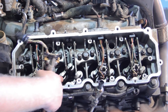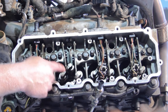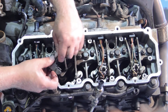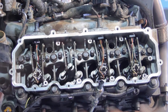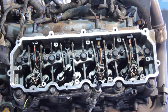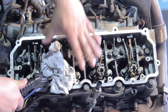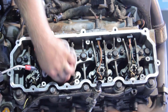We're going to take some shop air and blow it into the hole down here. Now remember, this is underneath the valve cover, so there's a lot of engine oil down in here. This is a blind hole, and so if that hole gets full of oil and now we go to torque this bolt down, it's going to cause some torquing issues and not seal the injector properly. So we need to make sure that all the oil is out of there. We've cleaned out our passageway where the new injector is going to go — just use a clean rag and a screwdriver. Now take a little shop air to that hole and blow that oil out. It's a good idea to cover this up because you don't want oil flying all over the place.